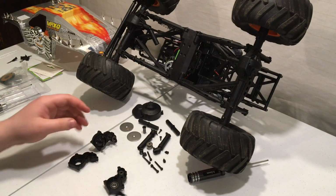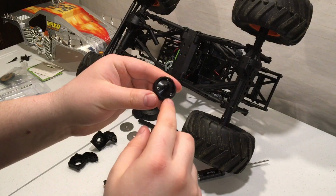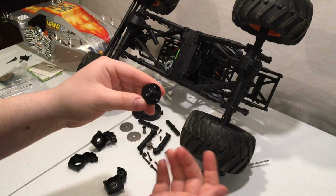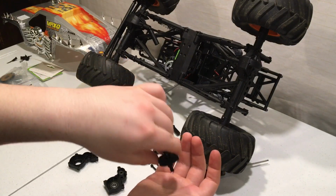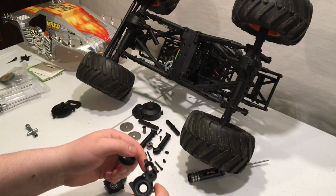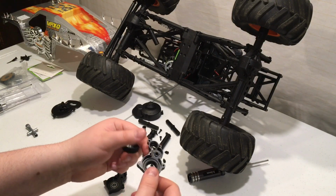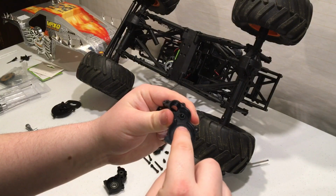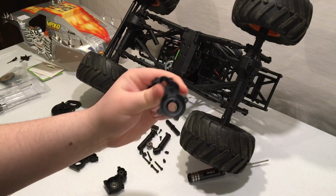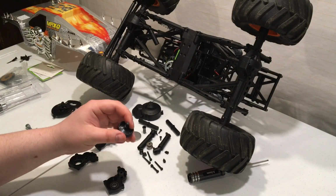I'll show you. Remove the output gear here. What keeps happening from the factory, these 3 screws that hold the output shaft to the output gear come loose. I guarantee you, and I tightened this recently. See how that one fell out? They keep coming loose. I had heard a grinding sound, and when I tore into this transmission initially, I found a bunch of plastic shavings. What it did was it stripped out about a 1/16 of an inch of plastic around that bearing there. What I suggest doing is taking that apart and applying some thread locker so those screws don't back out.